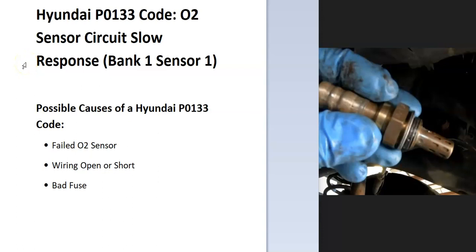Today I'm talking about a Hyundai with the P0133 code — what it is and how you go about fixing it. A P0133 code is an O2 sensor circuit slow response, bank one sensor one. The onboard computer uses sensors located on the exhaust to know how much oxygen has been burnt off after combustion, and it's seen a problem with one of these, so it's going to require troubleshooting to find out why.